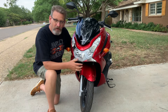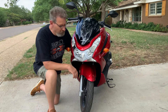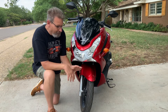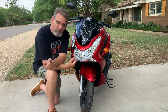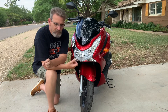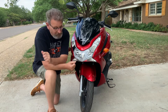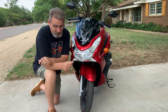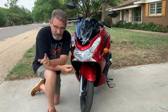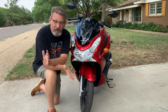When you buy one of these PCX now, you get the LED lights. But the incandescent is just fine. I love the front end of this bike — it's very aerodynamic. 14-inch wheels. On some of the smaller scooters, like the older Honda Elite scooters, they had 10-inch tires, which over railroad tracks or potholes can give you a little steer. This has 14-inch wheels front and back, which is a lot better when going over obstacles — it's a lot easier to traverse them.